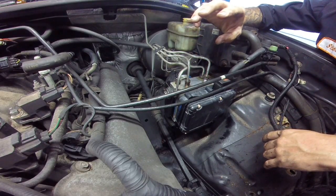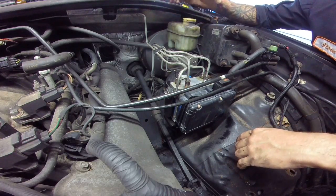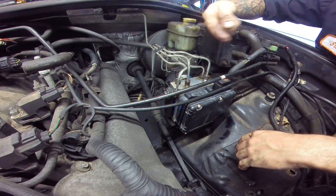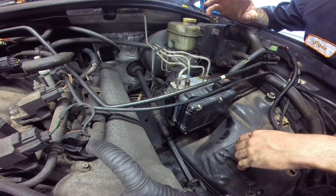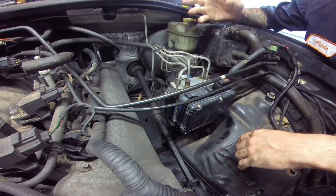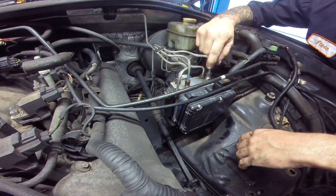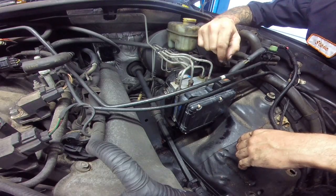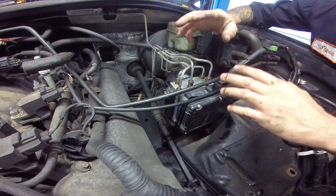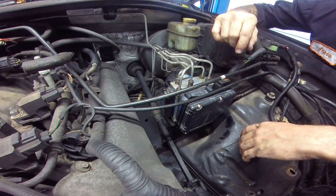So taking the cap off of this makes it to where it wants to flow, and the oxygen can come out, fluid can go in. This process, depending on the unit, could take an hour for each one. Once you start seeing fluid come out of it, stick your line on there. Wait for the next one, stick your line on there till you get fluid going out of all of them. Then have your buddy help you out, bleed it out, start in the back corner, work your way towards the front.